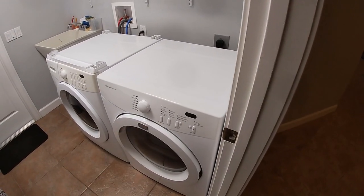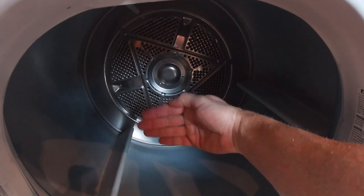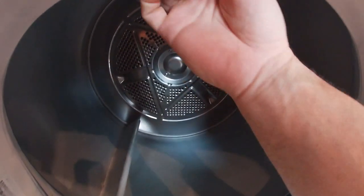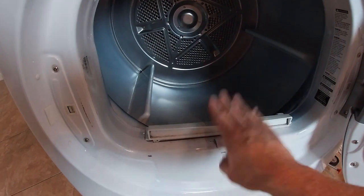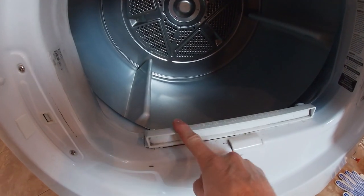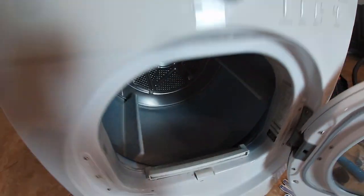Hopefully you guys can hear that. Let's get this dryer pulled out and over here so we can work on it. So the drum inside the dryer is actually tilting forward and backwards almost a half an inch. It wobbles while it's actually running and clothing is getting caught around this rim here and tearing out drawstrings and things like that. This lint filter has kind of become warped - you can see the side is bent there. This is getting replaced as well so the door can completely close and the lint stops going behind here, which is going into the machine. So let's focus on these things first.